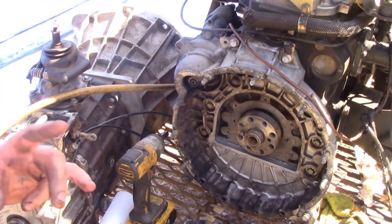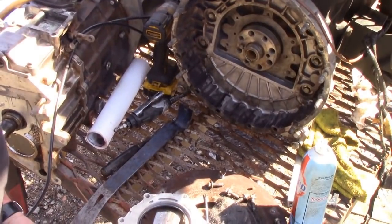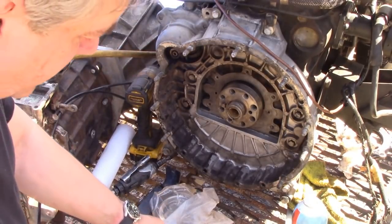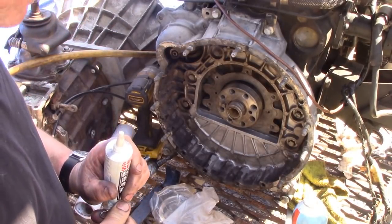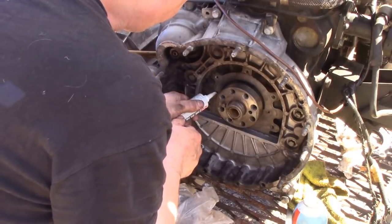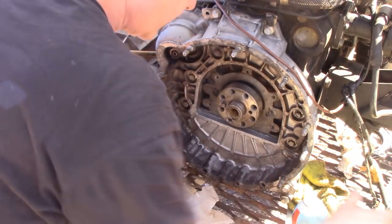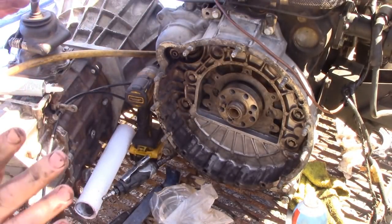So I'm going to grab a new tube of RTV. Okay. We're going to put it on. Be right back. Right, it's very difficult to see the screen in this light, but what's demanded is a 5mm bead across the bottom and then a 3mm bead all the way around. So it says, first of all, I'm going to put some into this hole here to give this a head start, because there is a hole there. It doesn't matter too much what it looks like, as long as it's sealed up. Right. There we are, so we've got one uninterrupted bead.